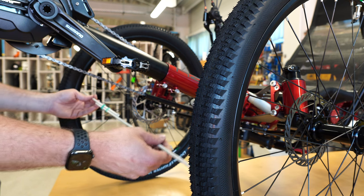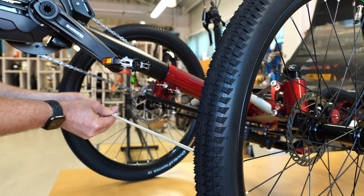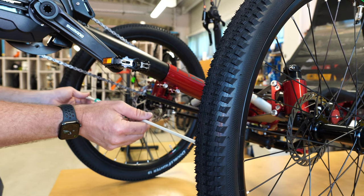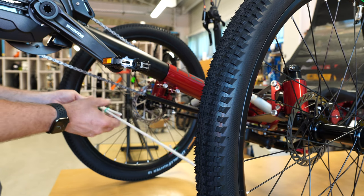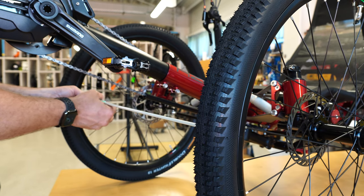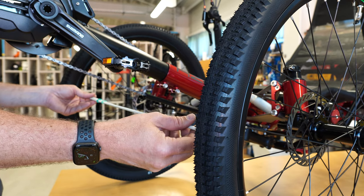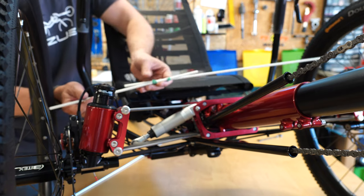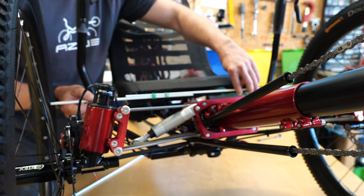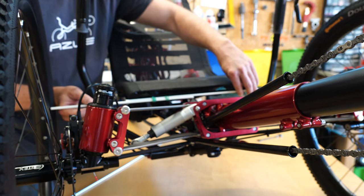To demonstrate with the handmade flagpole-and-rubber-bands measuring device, you simply slide the two lengths along each other to find that sweet spot, then allow the rubber bands to hold the two pieces together so you can use that same measurement between the rims on the back side. Taking that same measurement from front to back, we have a gap of two millimeters between the two rims along the backside of the wheels, just above the center axle.